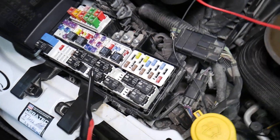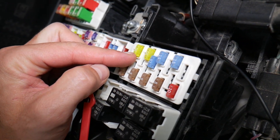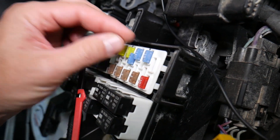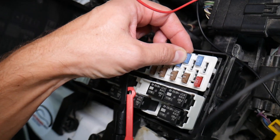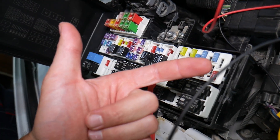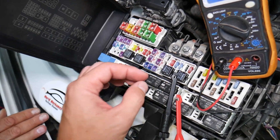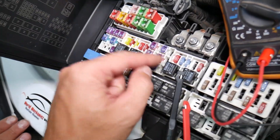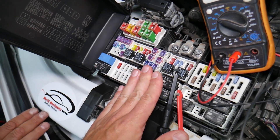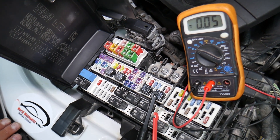Let me explain why it's super important to test fuses. Fuses — not often can you see if they're burned or good. Sometimes they may seem perfectly fine. You think it's a good fuse, put it back in, and you end up spending money and time on parts and problems that do not exist, when all you have to do is test your fuse, find out it's bad, replace it, and fix your problem. We will have a video on how to test a fuse, different kinds of fuses, and how to test relays. We'll put the link in the description below. Please check it out.